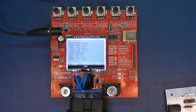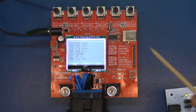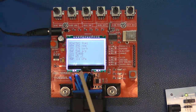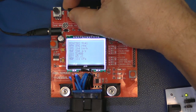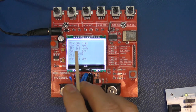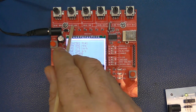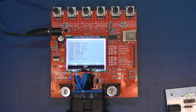I have an OBD simulator here that acts like a car - got this one cheap off eBay for about 70 bucks. You can buy good ones from real manufacturers for a couple hundred bucks if you're doing serious work. Looking at the simulator, you can pick various modes - right now it's set for ISO 9141. There are potentiometers representing different car parameters. I'm interested in vehicle speed, and if I turn this pot the speed shown in kilometers per hour varies. I also noticed the PID printed below it: 010D - that's what I'll be querying.